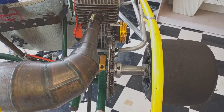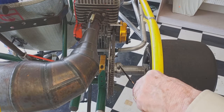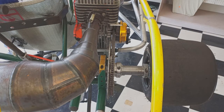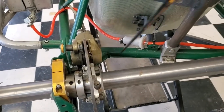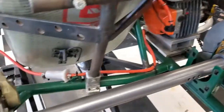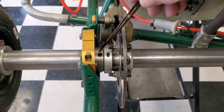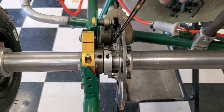It's critical to get the sprocket on the axle exactly lined up with the sprocket on the clutch. Even being a little bit off will eat up the chain, the sprocket, and the clutch sprocket, or all of those. So take the time to get it perfectly aligned. But lining up the sprocket won't do you any good if the axle can move from side to side. You should be using locking collars on each side of the axle to prevent it from sliding side to side. You can put the axle collars either on the inside or outside of both bearings, wherever you have room. You can't depend on the set screws in the bearing to hold the axle — they're intended to keep the axle from moving inside the bearing, but they cannot manage the tremendous side force the axle puts on during cornering.